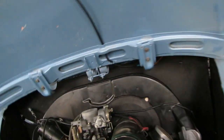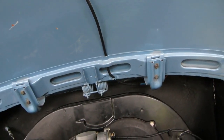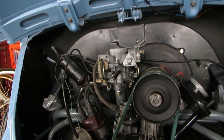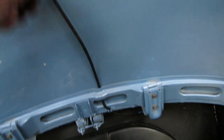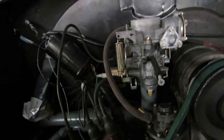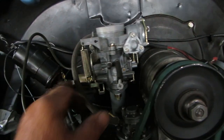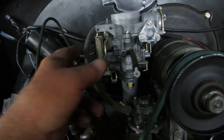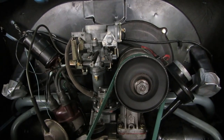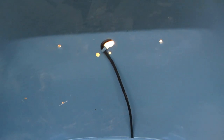And then through there, and then you've got yourself a neat little setup. Another thing about this particular wire, if you can armor it, it's even better. All the way back to the firewall, if you can have some sort of metal something and secure it very well, because you slim jim the door on these vehicles without an ignition lock, and pull this off the bottom of the light and stick it on the distributor right here and go inside the car and pull the light out one click, powers your choke, and you hook it in gear and give it a push and vroom, you're gone. See, you don't even need a key. How about that? So yeah, anyways, that's how that goes.